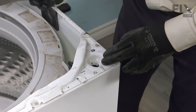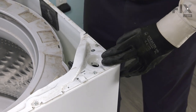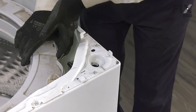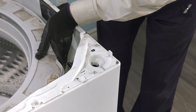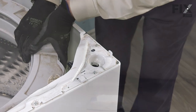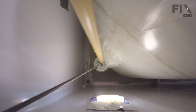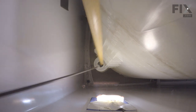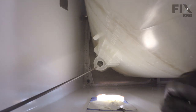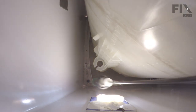Next, we need to disengage that from the side of the tub, so we're going to use a long-handled instrument such as a broom handle, and we're just going to knock that through the mounting on the side of the tub. We're going to push down on those locking tabs on the side of that bushing. Once we knock that down through the opening, we're going to lift that rod right through the slot on the side and pull it completely out.